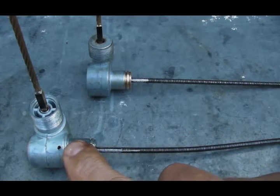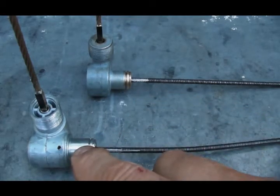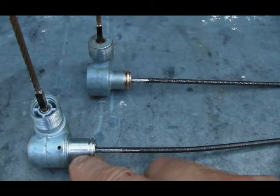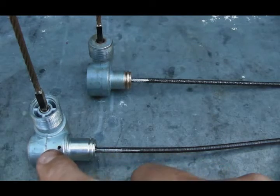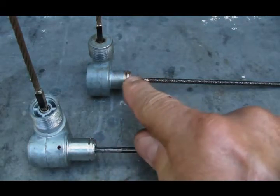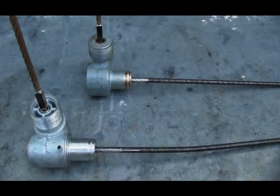He extracts the spur gear, removes the little stubby cable that's permanently attached to the gear, crimps to hold the square end on a new spindle cable, and then machines a new end. You can see that the metal here is all shiny whereas the original is not. These are two separate metal pieces joined together by a roll pin, and he has to machine a piece that emulates the measurements of the original drive to accept the spindle nut. As built, these aftermarket drives would not take a spindle nut — it wouldn't even fit.